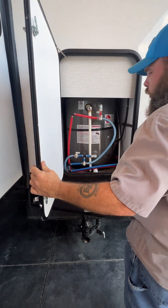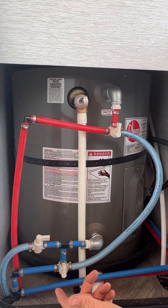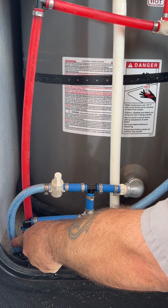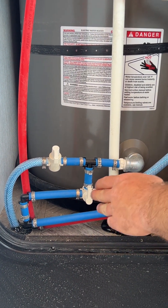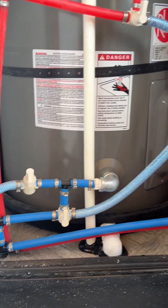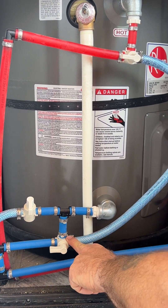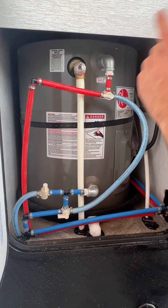Inside here is where that residential water heater is going to be located. I had this open so I could drain the water out so it wouldn't get stagnant. To drain it, you open this for top airflow, and then this valve is what you turn to drain the water heater — it has a hose that comes out and drains right out. This inline valve here allows antifreeze to bypass the water heater when you go to winterize your coach. You turn these valves so the antifreeze goes up and around the water heater instead of through it — you'll use a lot of antifreeze if you don't bypass this.